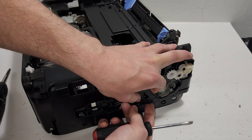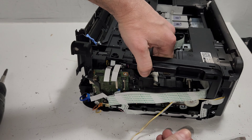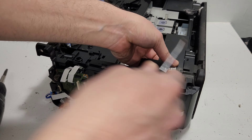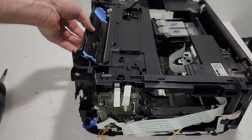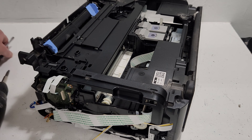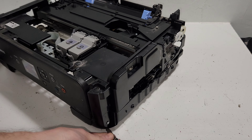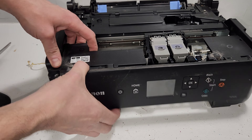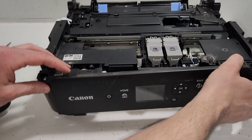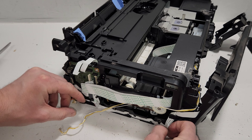Push the panel to the back, then to the left side. Let's also remove this screw right here that's holding it back. There's the front control panel — and another screw right here. The front just slides up after you remove the screws, and these left and right panels slide up and slide out. Watch for the wire here to avoid ripping it.